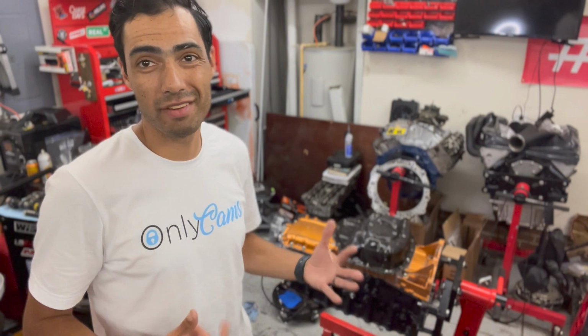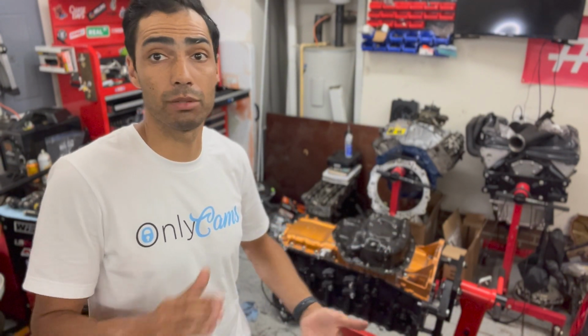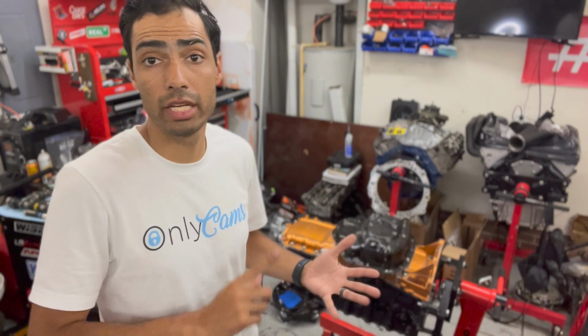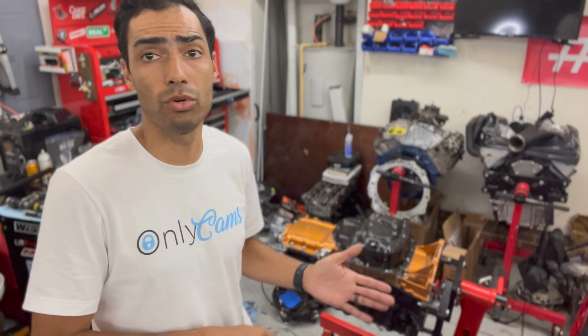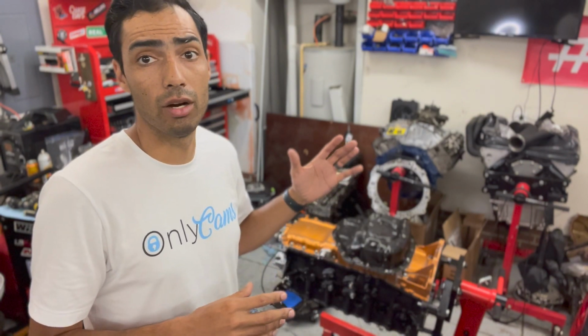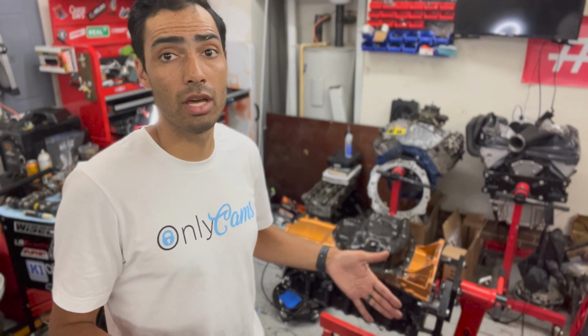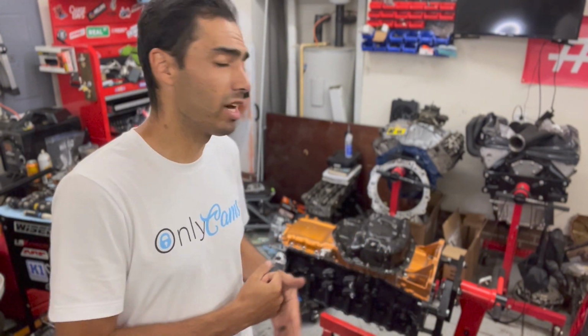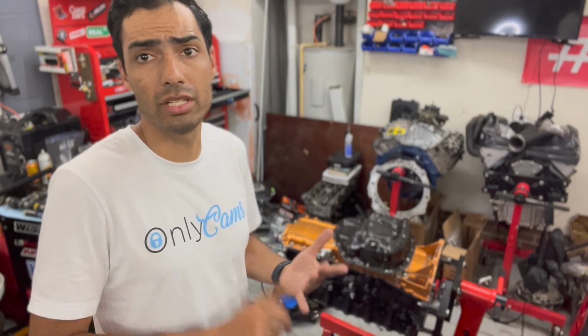All right, guys, well, that's gonna be it for this video. We got the complete short block done. Everything from rods, pistons, crank, bearings, upper and lower oil pan, baffle, all that stuff. Oil pump, front and rear main seals, all that's done. Only thing left is to throw the top end on, which is going to be, of course, the heads, cams, and everything else.